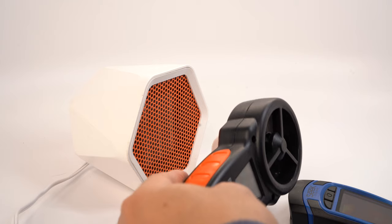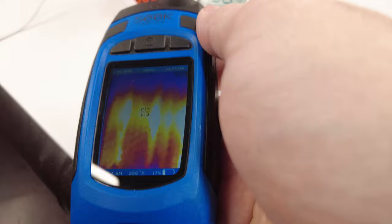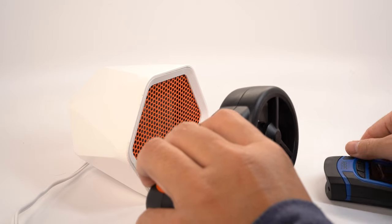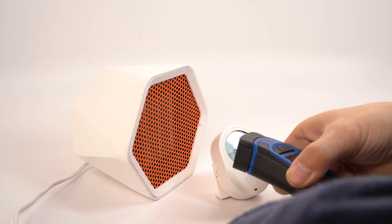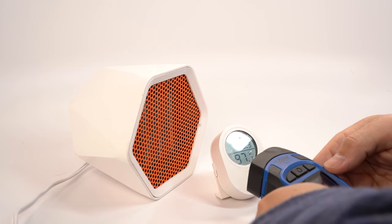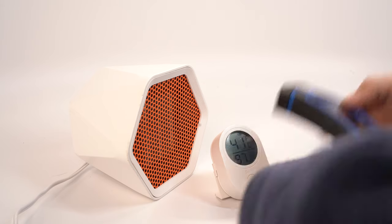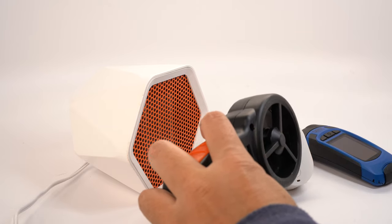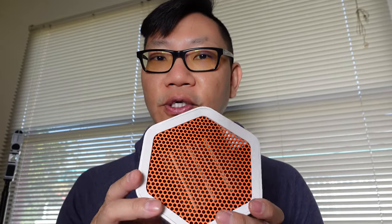You can see the thermals here — the thermal camera is showing 240 to 260 degrees Fahrenheit coming out at the low setting. Let me try the high setting. On high, we are getting closer to 300 and 313 degrees Fahrenheit, and airflow is at 3.5 miles per hour. There's nothing like actually feeling the fan yourself to figure out whether it works for you.